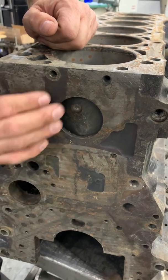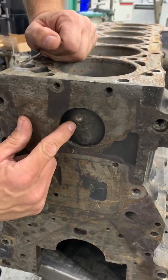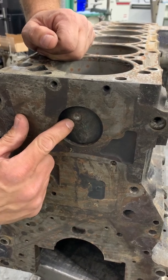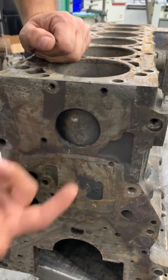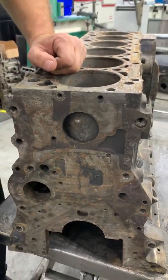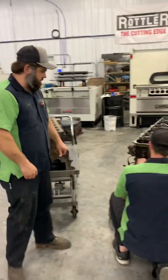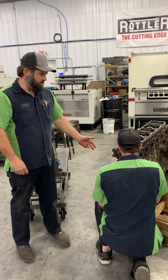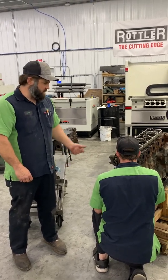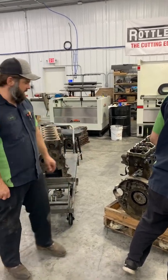You can see why we chose this block to demonstrate on: some nice person decided to drill that rear freeze plug out, and you can see the outcome. They drilled it and left about 60 thousandths wall thickness in the cylinder, so we wound up building an engine for this and the block is now junked. One thing to talk about: you're going to have to clean the threads out in the block. Nothing's ever been in those holes, so you need a tap, thread chaser, or thread tool to get in there and clean them out.